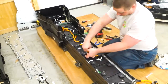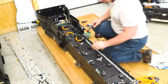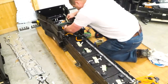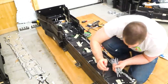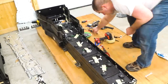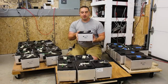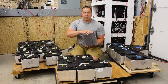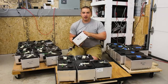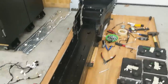When I got to take these apart, the first process was getting the black cover off. But before I could get the black cover off, I had to disconnect the large orange plug. Then I could take off the large steel cover and that would reveal the beautiful assembly inside. One of the reasons that BMW encased these cells in aluminum is because they ran an aluminum heat transfer plate on the bottom of every cell, probably relying on the aluminum casing to help spread that heat into the water jacket for the coolant system.